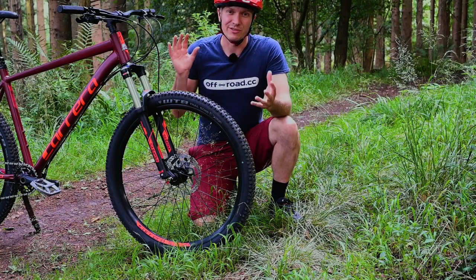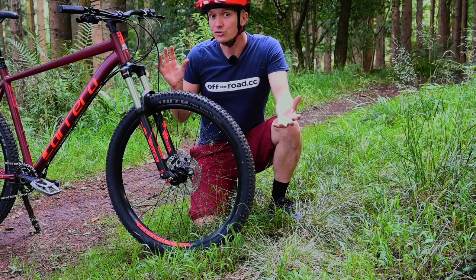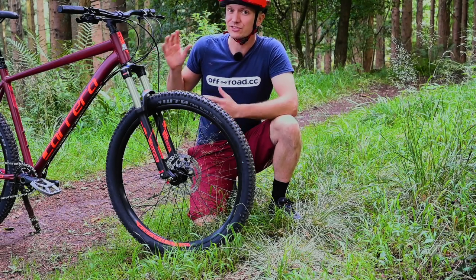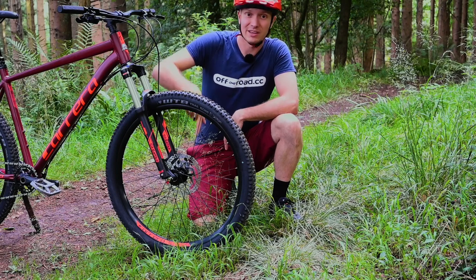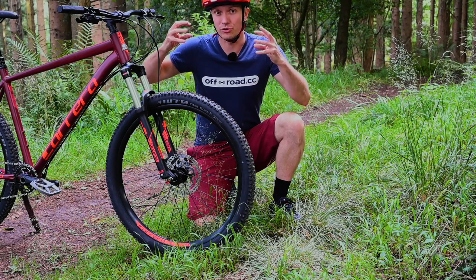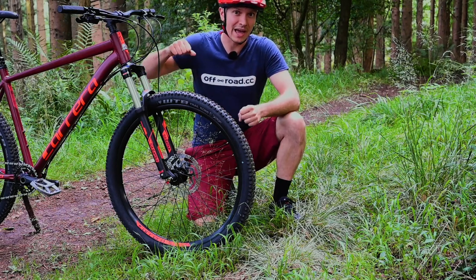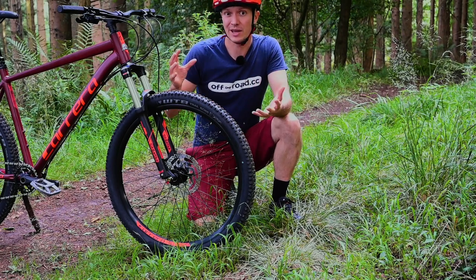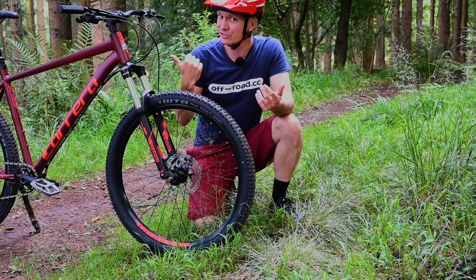When you're buying a budget bike, the devil really is in the detail. While it's not uncommon for a bike at this price to have a 120 millimetre travel fork, the Fiori is set apart from its competitors in a number of ways. First up, it actually gets a proper through axle — a 15 millimetre through axle. That means the front wheel is held much more securely, it's much more rigid, that means better handling response, you can really lean into corners and it's just all-round more secure. You don't see that on some thousand pound bikes, never mind one that's 600 quid.